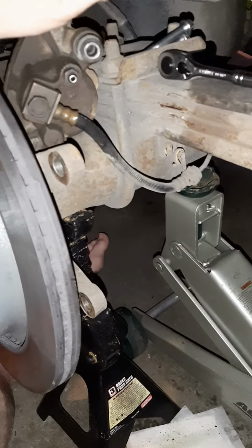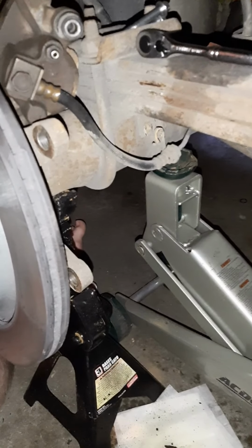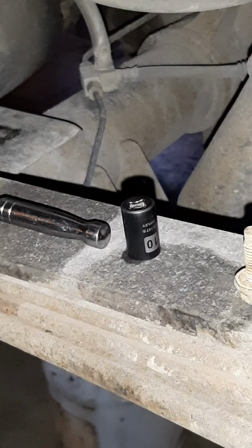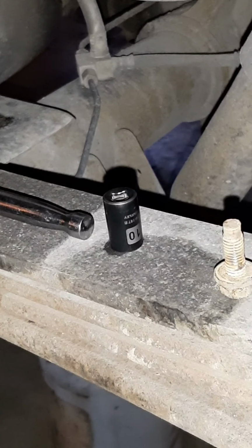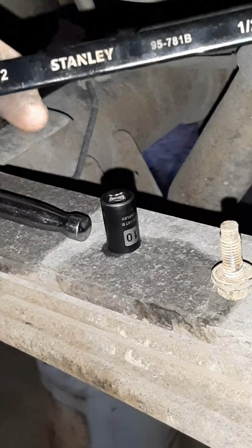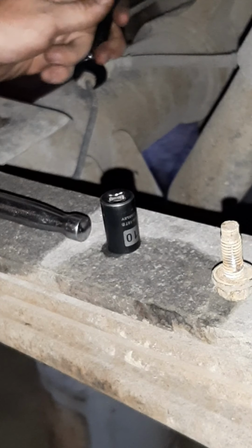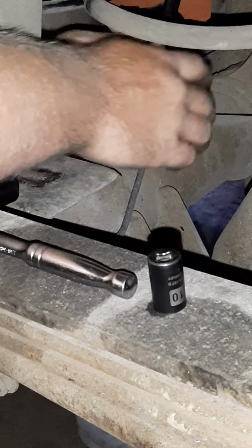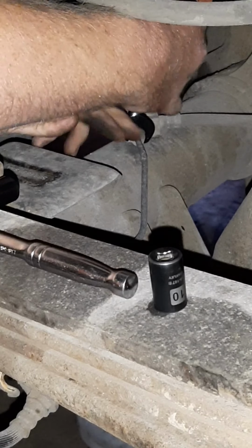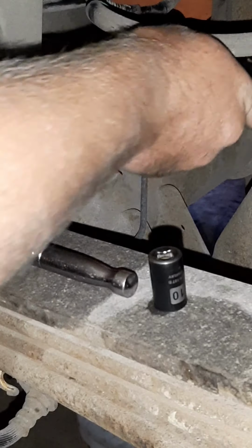Then next, we're going to move to the back to disconnect our brake line. Next, we're going to take a little catch bottle and stick it right down there. And then we'll adjust it to see where the brake fluid's coming down. Right here, I've got a half inch wrench. So I'll hook onto it here. Get a little better view. Going to start loosening it.